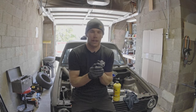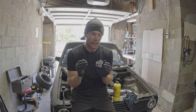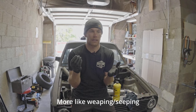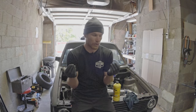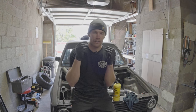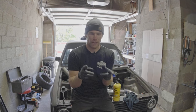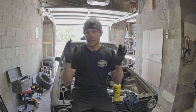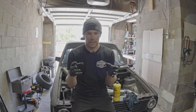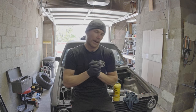I actually really like the result. I think they're very nice brakes, and now I also have a brake bias adjuster as well. But I've had problems with that stack of fittings leaking because I didn't use sealant or tape, or they just weren't tight enough. I've already redone them once before with tape, but this time I redid them with sealant and made sure they were very tight. I took the fittings apart right after the master cylinder, so there's now definitely air in the system for all of the brake lines.